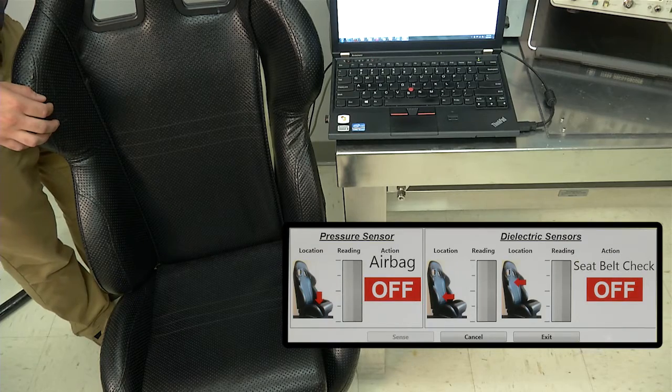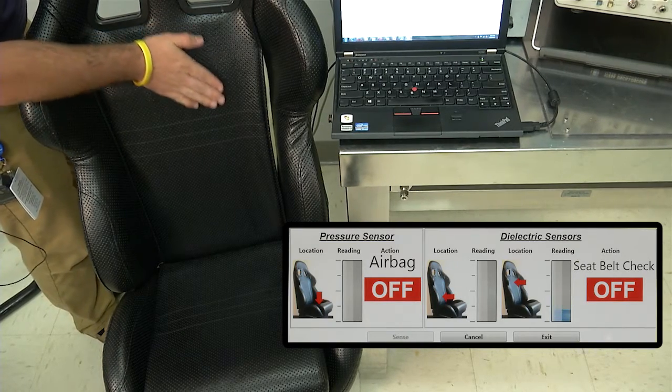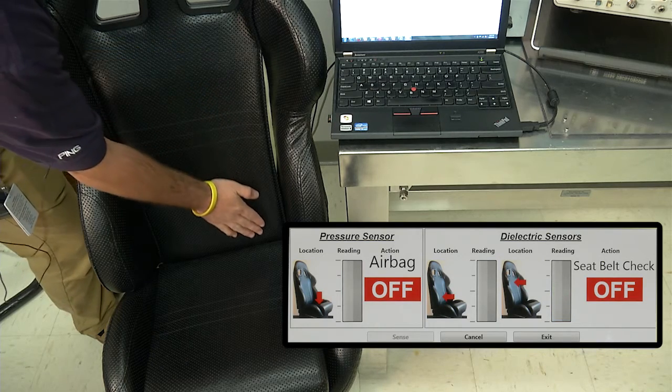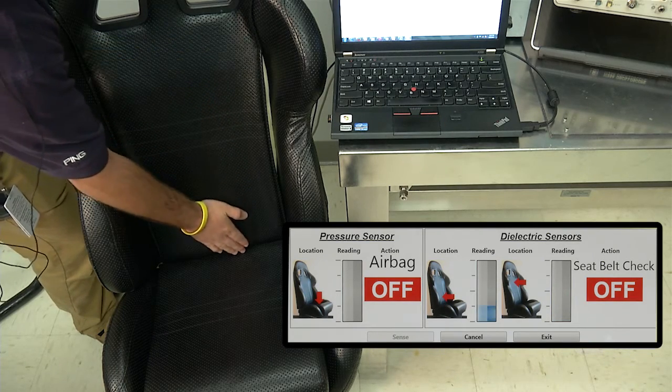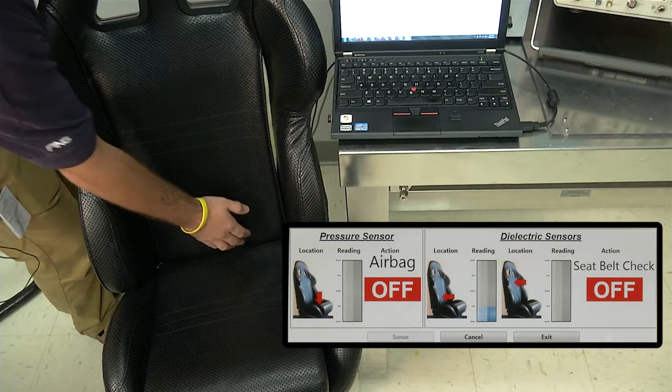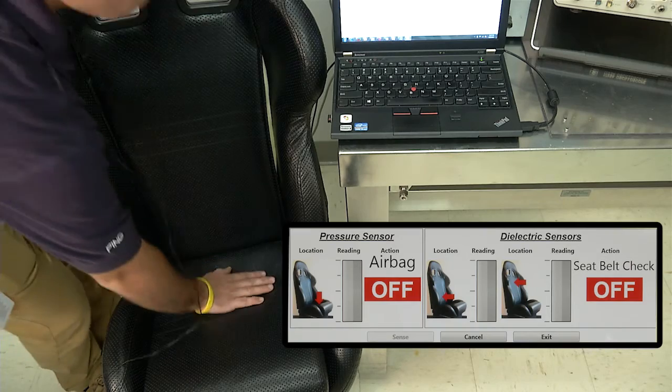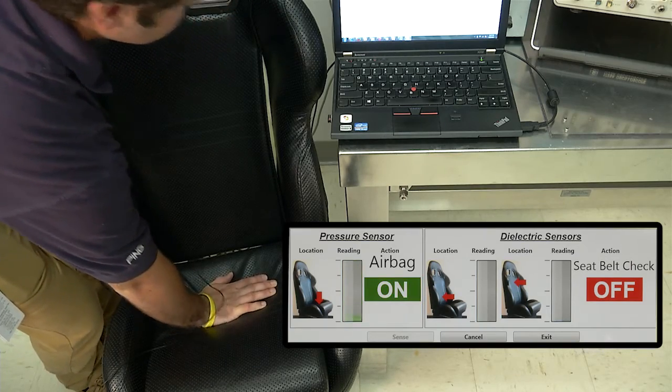The moisture tags provide human detection within the seat in order to better control the seat belt warning indicator within today's vehicles. By detecting and compensating for the impedance drop that my hand creates in the electromagnetic environment, the sensor is able to take that compensation value and send it as a 5-bit sensor code to the RFID reader. A back-end 8-bit microcontroller can process the data and determine any associated action to take, whether it be seat belt warning or airbag on-off regarding pressure in the seat bottom.